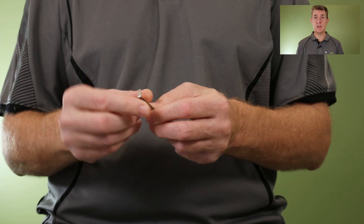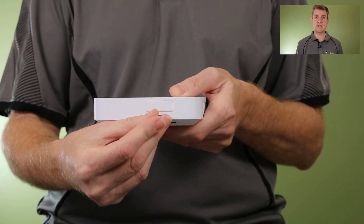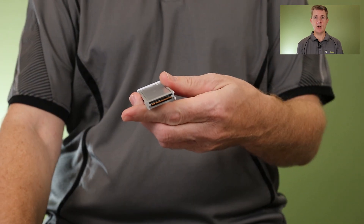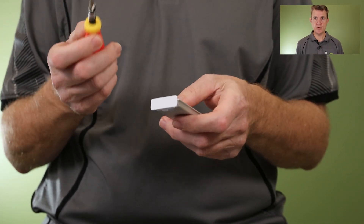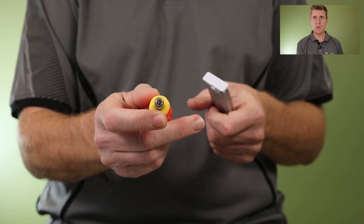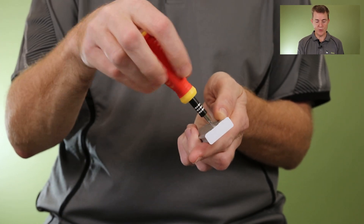I've got our quick release tool here, and we can push this into the side of the unit. You might buy this already with storage built in. Let's pop that open and take it out. Here we go — this is the drive tray itself. It is fully self-serviceable. Reach over here for the screwdriver — it does use a star-head tool, so you might need that. All we're going to do is take off the cover and run this screw out.